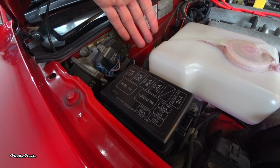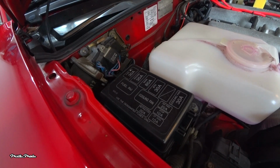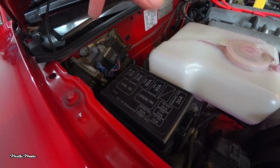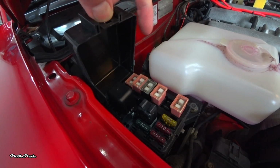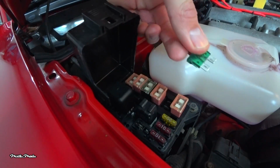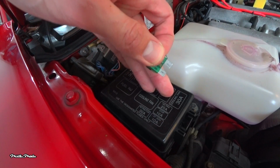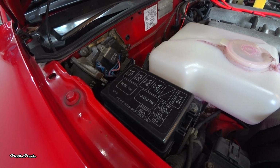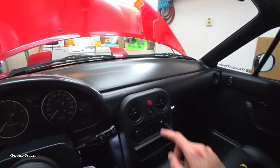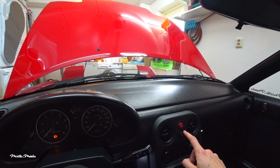If you want to keep all your fingers in good working condition, I suggest you either disconnect the battery or remove the headlight retractor motor fuse. Open up the fuse box and remove this fuse. The headlight lid will chop off any fingers that are in the way when it comes down. With the fuse removed, your headlights won't go up or down anymore.